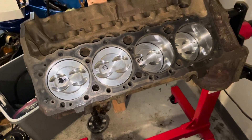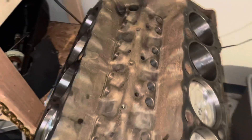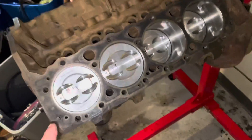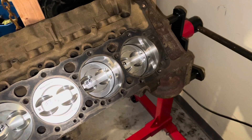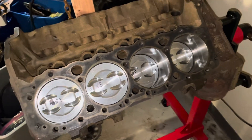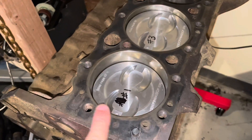If this was a car, it would be the driver side. First thing I do is get a rag and wipe down this surface. I'm going to tilt this thing up to where the cylinder is almost perfectly vertical. I won't go completely vertical — I don't want oil on this side to spill out of the cylinder. I'm going to go almost vertical and then take acetone and a rag and wipe the surface down, get it absolutely clean with no oil stains or smears. You want this surface to be squeaky clean before you put the head gasket on.